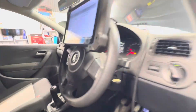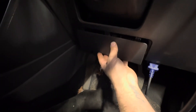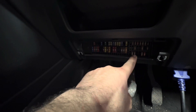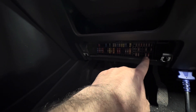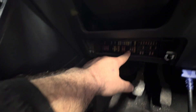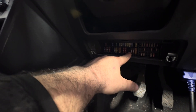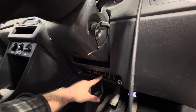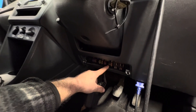I'll show you where the fuse is. This is a UK car, right-hand drive — driver's side, underneath the dash, we have the fuse box. There's a cover; you just pull it and the cover comes off. If you look closely you can see the numbers on the fuses. Autodata said fuse number F28, which is right here. I haven't put it in yet because I wanted to show you the fault codes we were getting, but I pulled it out and the fuse was blown. I'm just going to replace the 10-amp fuse. This is a good video for someone who has this problem and a basic diagnostic tool and wants to fix it themselves. Thanks for watching.